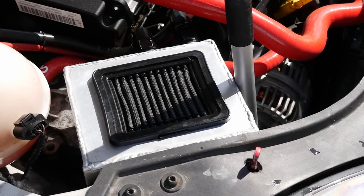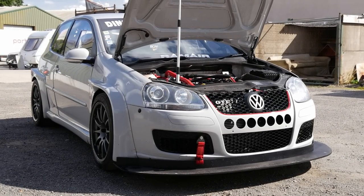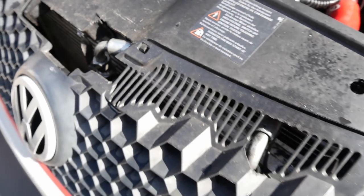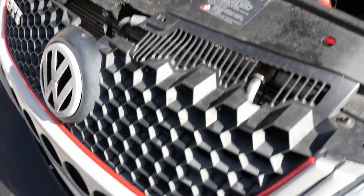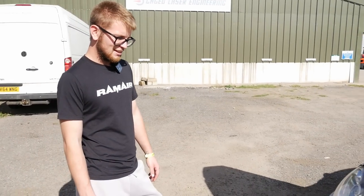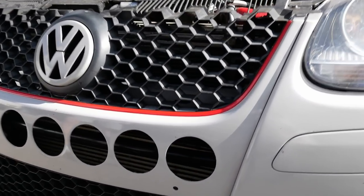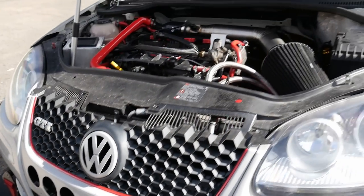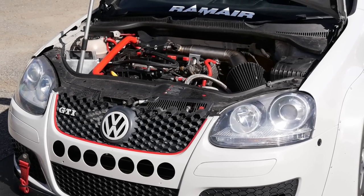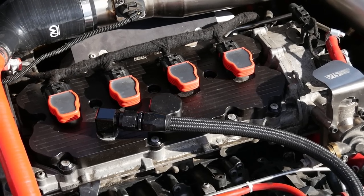What's this over here? The catch can — yeah, custom-made catch can. And then you've got obviously all the usual intercooler and oil cooler. So it's an alloy-ended S3 cooler, nothing too special, it's enough for what I'm running. 25-row oil cooler. I want to do this to mine actually, because it does look quite cool. Obviously extra cooling, definitely helps, especially with the custom crash bar behind as well — a nice thin crash bar to help get air to it all. I'm liking this as well — a lot of custom work. Titanium — this is a good friend of mine, Eddie. That's a titanium intake, fully custom. Really nice, he did all my boost pipes as well, so we don't have the horrible sandwich throttle pipe.